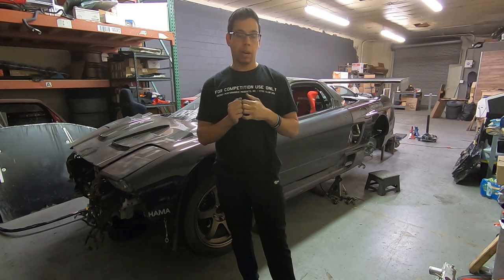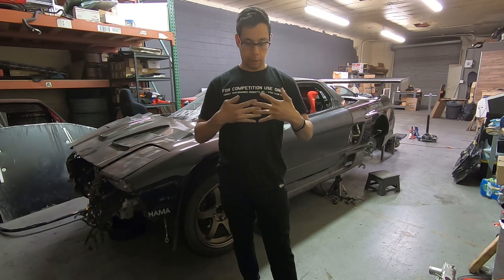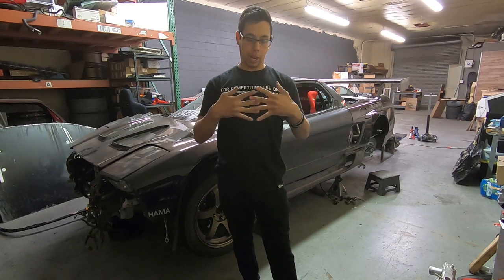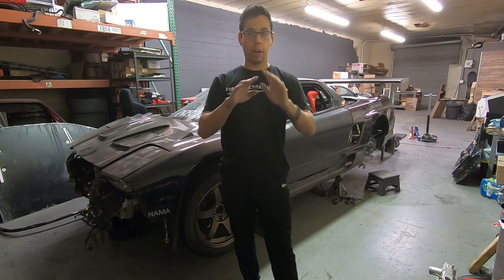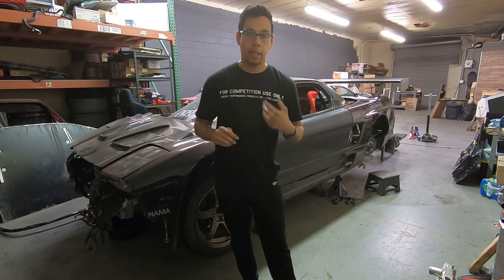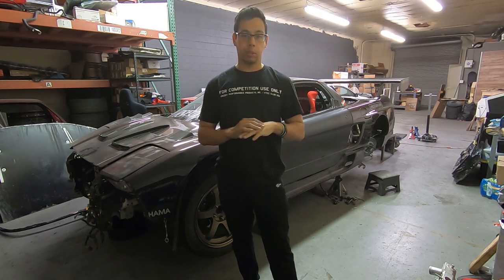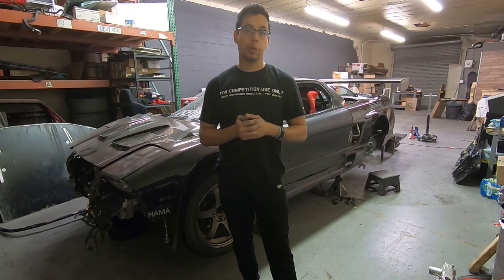However, they are weaker because you also have an axial loading. Whereas with the Dogbox, the gears are loaded and want to push themselves apart. In a helical cut gearbox, they're pushing themselves apart and they're also pushing themselves up and down. So the shafts that the gears ride on are working in two different load areas, two different planes. And that's probably what shredded the gears on this transmission that was in the car. Third gear is basically non-existent. There is no third gear left there. And the straight cut gearbox gets rid of that.